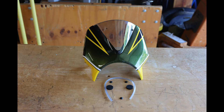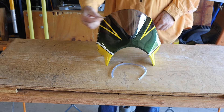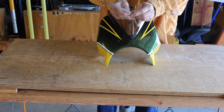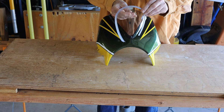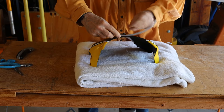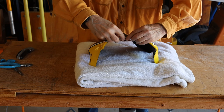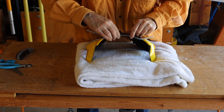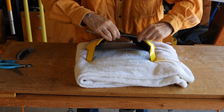These are the doodads: the slit tubing to keep the front fairing off the headlight rim, the three flyscreen screw button caps, and the two foam bumper protectors to keep the fairing from hitting the tachometer and speedometer. The slit in the tubing is really there. I bent the tubing sharply to get it started, then pressed the tubing in place — keep it just above where you want it to go in, don't let it dangle.